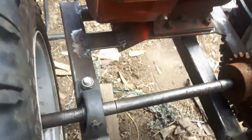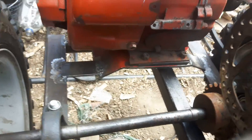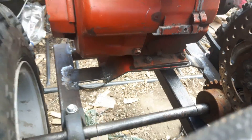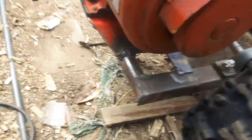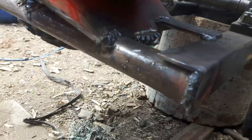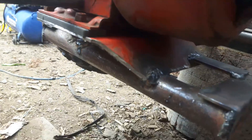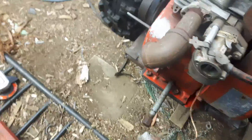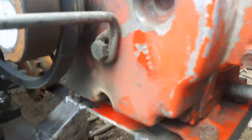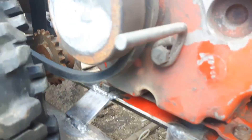Motor mounts — I had the plate from the snowblower before, it had a crazy bend, so I just kind of worked with it and made it fit. The very back part itself is a piece of one-inch schedule 40 pipe. I still got to finish up my welds there. I just cut it basically after I got it where I wanted — cut so it would look all pretty — and just a little spacer down under there, and I'm running an angle bar up to there.